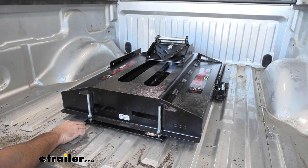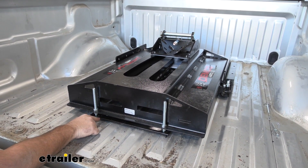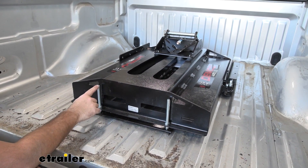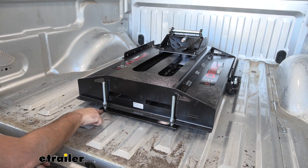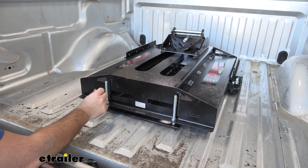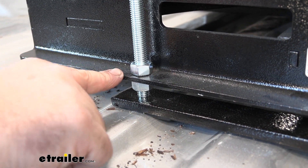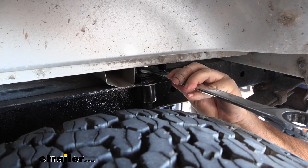Once you get your side brackets mounted and your hitch base sitting in place, this little plate and these long bolts that come in the kit are to keep the front of it from shifting. You want to make sure this is on before you go down underneath and start tightening up your hardware. Take this bolt, feed it into this hole through this plate, put a nut on it, and thread it into the weld nut in the bottom bracket. Do one on each side, then thread it down until it stops. Tighten this nut up against the bottom of the plate and then tighten this nut down onto the plate — that's going to keep the front part of our hitch from shifting. We're going to use a 15/16 socket wrench and it may be a little bit easier if you use a swivel and come from underneath.